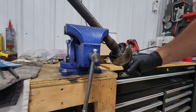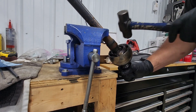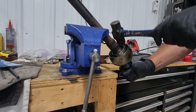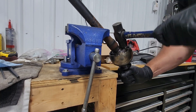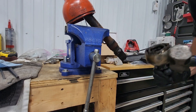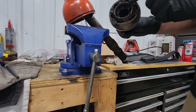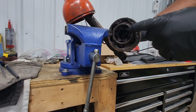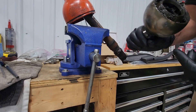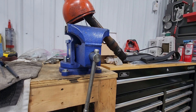As you can see, see how loose that is in there? You can hear that rattling. So now you're just going to strike this. What I'm striking on is this inner cage — that's going to be replaced anyway. Now I'll take the inner shaft and get that out of the way so we can get the stub shaft in to disassemble.